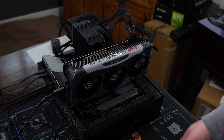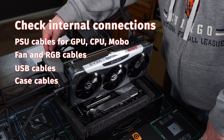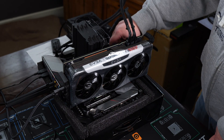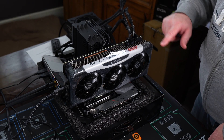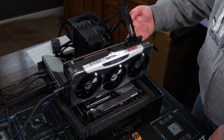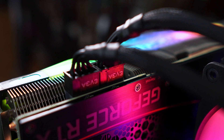Now that we've checked all the external connectors, we want to go inward. The first and easiest things to check are your GPU power connections, your CPU power — you might have an 8-pin and a 4-pin, or two 8-pins — so make sure they are fully seated. And then your motherboard 24-pin cable, make sure that's fully seated as well. On most GPUs, if the cable is not delivering power or not fully seated, there might be a red light indicating it's not getting enough power. You can unplug it, replug it, or try a different cable if you have a modular power supply.